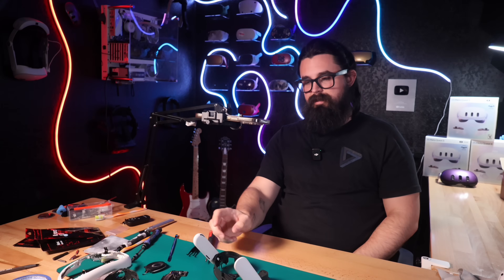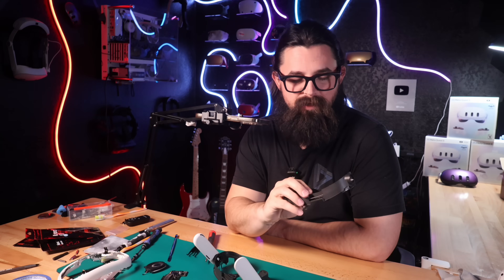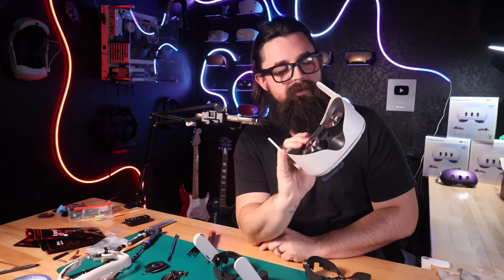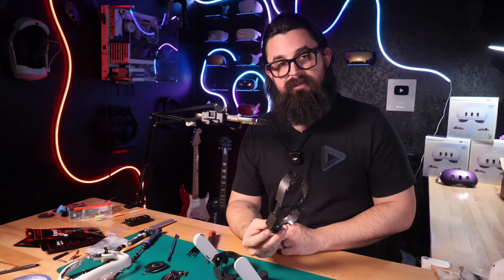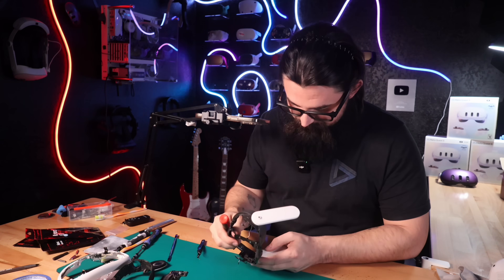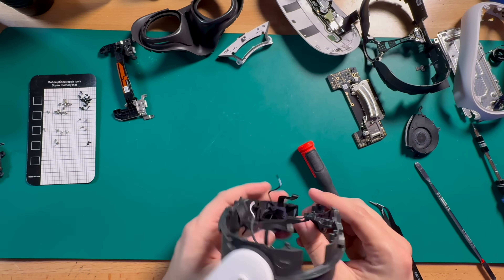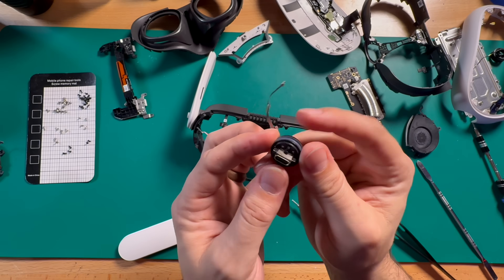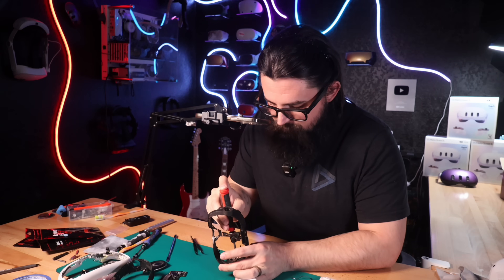We're almost done. Now I just have to take the speaker arms off and swap them onto the new frame. Swapping a frame — or whenever people have broken head strap retainers on the Quest 3 — is a total nuisance because that's part of the frame. I miss the Quest 2 design where it was just a separate component that could be unscrewed and screwed back in — that was such an easier repair. Meta made this part of the frame because it's such a high stress point, but they didn't build them to be fixed, they built them to be sold. I'm curious whether the mounting rings themselves have suffered any damage — it's pretty common for the rings to fail before the frame does. That ring looks like it's in pretty good shape, no cracks, no stress fractures.